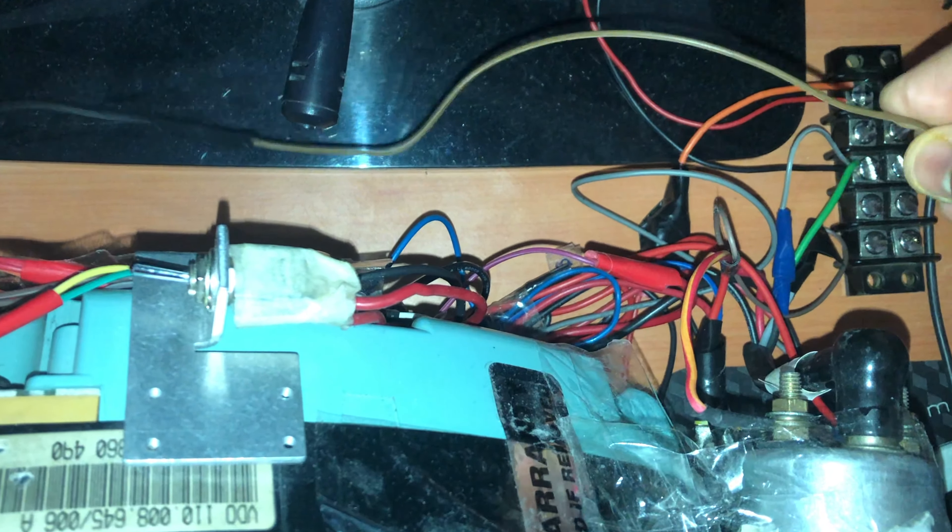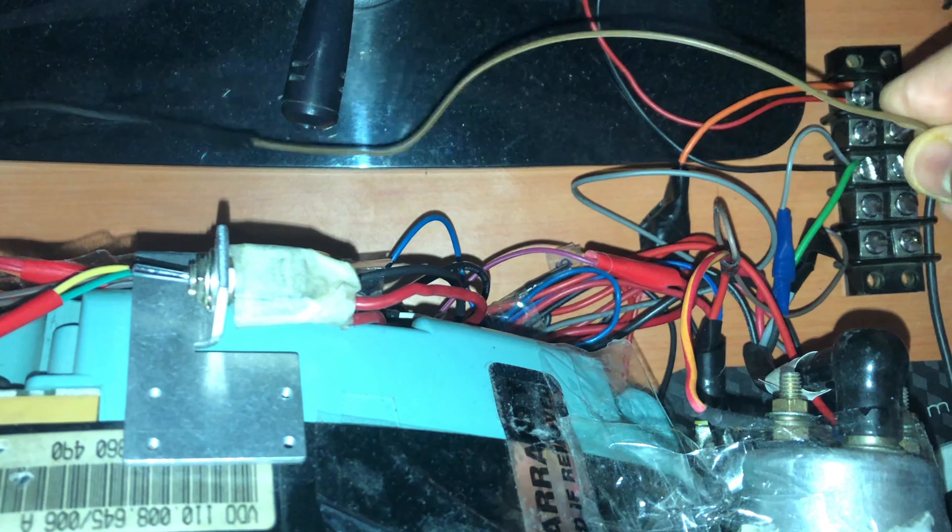Here's my power supply — this is the positive terminal and this is the ground terminal. It's a 12 volt supply. I'll be connecting this service interval reset jumper wire to the negative pin for a certain duration, and that should reset the oil service and inspection lights.